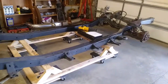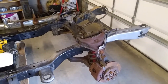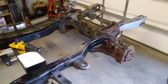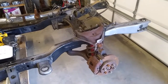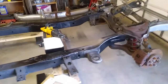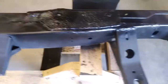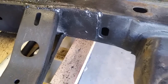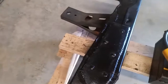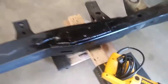My kids will probably be full grown before I'm done with it. I'm trying to do this on a low budget, not put a lot of money into it. I've put a late 90s — either a '98 or '99 — Dodge Dakota chassis on the front. I hate to call it a front clip because it didn't unbolt; I had to cut the original Dakota chassis and weld it into the original '51 frame. Those welds aren't pretty, but they're gonna hold. I put box and plate welds top and bottom — I think those are called button welds on top. I don't know all my terminology; I'm just putting it together as I can.